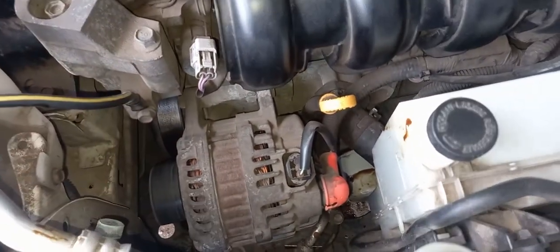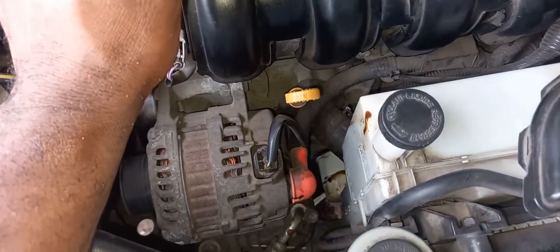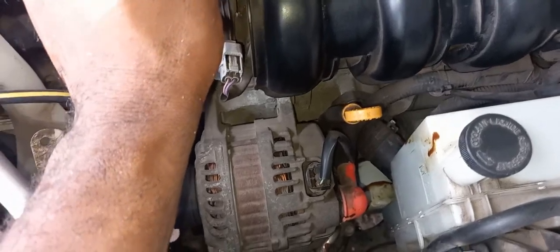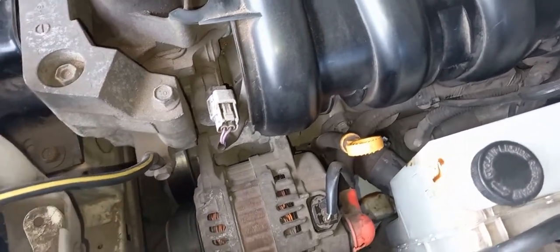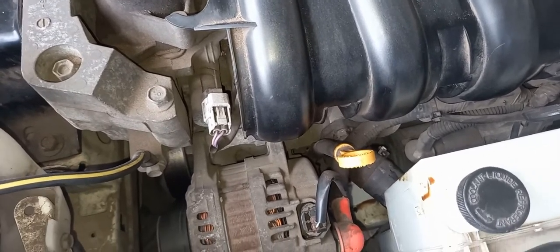You're not gonna turn it clockwise — if you turn it clockwise that is you tightening the oil filter. Now some persons might not be able to grip it. What I would have done, I would have used a screwdriver to actually bore the oil filter and rotate it anti-clockwise.